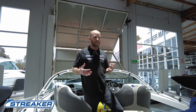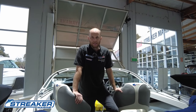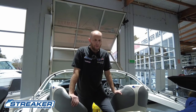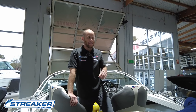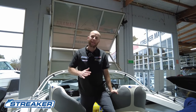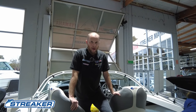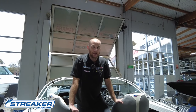It's all preventative maintenance — all the stuff we're doing at the annual servicing is typically about prolonging the life of all the products inside the boat. First service will be at 20 hours. Listen to your owner's manual and the people you're buying the boat from. Keep it under 5000 RPM, go through that rev range from idle to 5000, and give it a good vary. Once you've done four or five hours, depending on the motor, you might be able to bring it up over 5000 for short bursts. After your first service, you're good to go. If you're doing around 100 hours or less, service it once a year. If you're active boating and doing over 100 hours, look at getting a service twice a year.